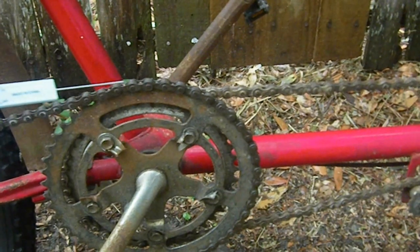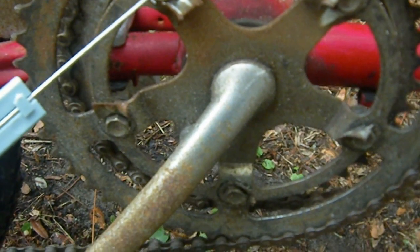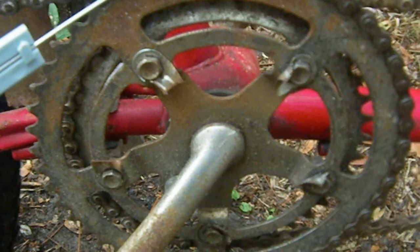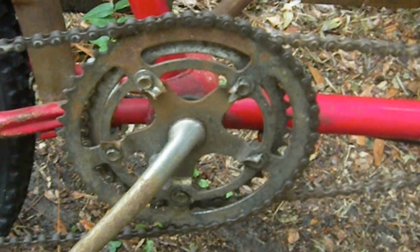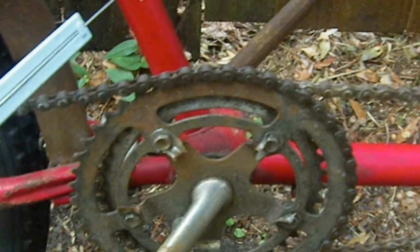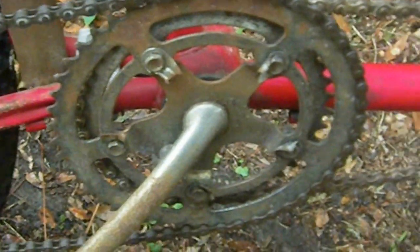This chain falls off on the outside. Now, why does it fall off? What I figured out is that at one point there was a chain guard here. I looked it up on the internet and it said the chain guard prevented the chain from falling off. I cannot find any place to get a chain guard — for some reason they just don't sell them. But I read on the internet that what you could do is mount a front derailleur here without cables or anything, and just have the front derailleur keep the chain from falling off.